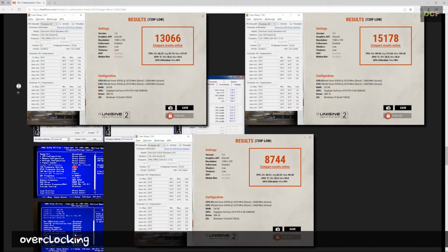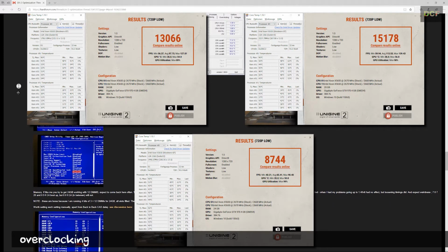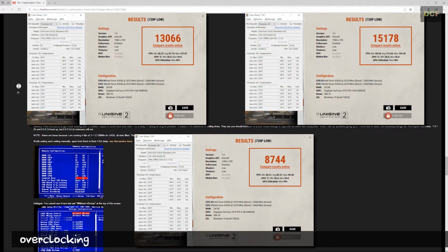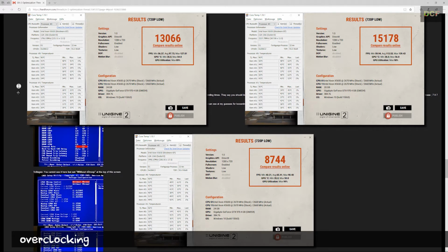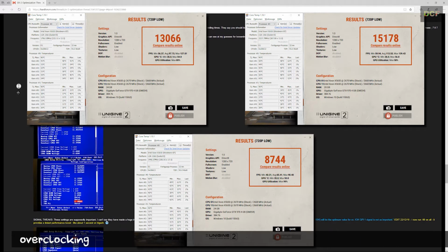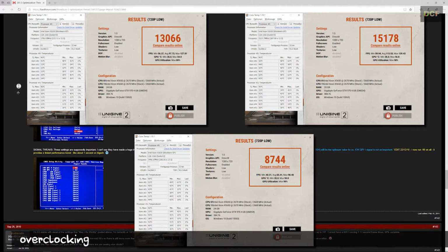I assume three possibilities. First, some component gets too little voltage. Second, some frequencies are running out of sync. This was sometimes an issue I encountered regarding overclocking in the 90s. And third, simple overheating of components. I need to investigate this behavior. Maybe you have some ideas.